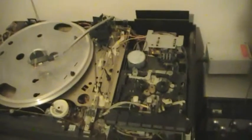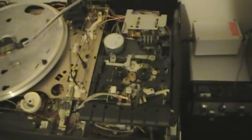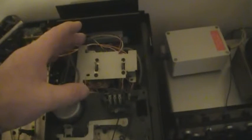Going to have to take the cassette deck out to see where we go from here. The thing I like about this unit is that it's so serviceable — you can get into everything. I've taken two screws out of the panel that has the switches for tape select and hiss and noise reduction, so I can move that back out of the way. It's four screws on the cassette deck, one on each corner, and the whole cassette deck can lift up and you can get right underneath it. I can actually see a rubber band lying in pieces under there — perished. So my previous rubber band repair needs to be redone, or something better done.